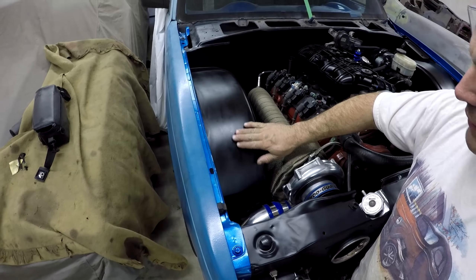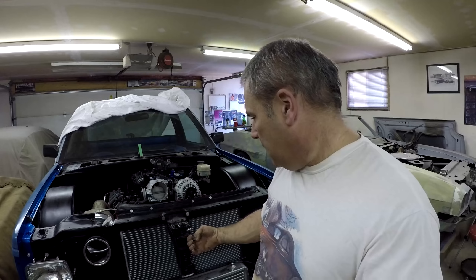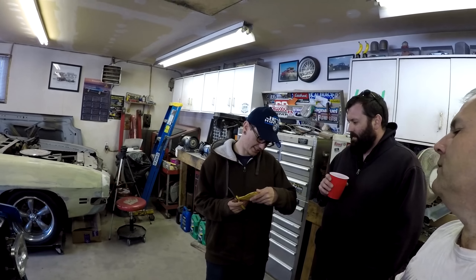Now it's the next day and I'm out here again. My plan today is to sand this fender - it got some runs in it, I put the paint on a little too heavy. Everything else is good except right on top, so I'm gonna sand it down with some finer grit sandpaper, mask off the blue, and then repaint it. I'm also gonna paint the hood hinge, take off the hood latch assembly and give it a quick paint job, paint that little opening latch I made for it black too, and then look for the front cowl that goes for the windshield wipers.